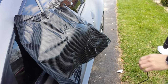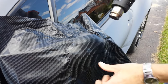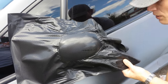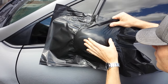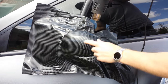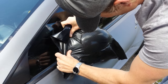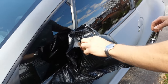Now I'm going to show you how this works up here by taking the vinyl and heating it again — and relaxing it. All those wrinkles that were there are now all gone and I didn't even stretch it, that's just how it goes all the way around. Just kind of fold it around. There might be areas where you have to stretch a little bit, but all in all you shouldn't have to stretch very far at all — I'm not stretching it right now, I'm just maneuvering it. The vinyl is now relaxed on the edges. If I heat it up, it doesn't pull back. That's what a lot of people run into on highly curved areas — pullback on the vinyl.